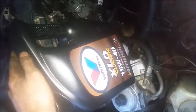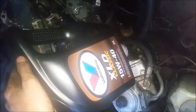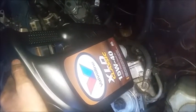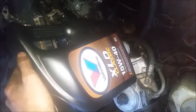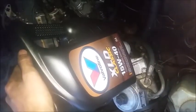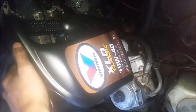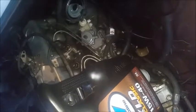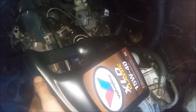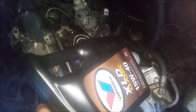Now that I've changed the front crank seal — because I had to cut it — there were a lot of little tiny metal shavings that came off. So I'm doing an oil change to flush it out. I've already rinsed the front when I had everything apart. I've now drained the oil and I'm going to put some more in. I'm not going to run the engine for at least 24 hours until the sealant has enough time to cure properly.